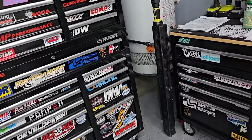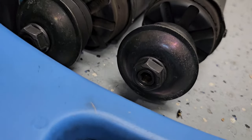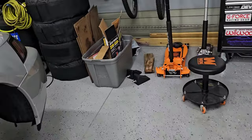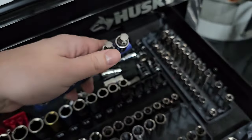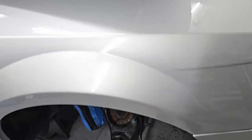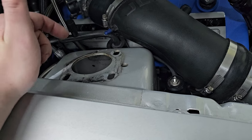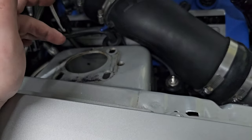Just a side note: to get the front struts off, you'll notice the nut on top has a hex — like an allen key — in the top. You're gonna need something to hold that. What I found works best is little hex sockets on a ratchet, and then you need a big wrench to get the nut off. You could take the nut off with everything connected, but it doesn't really work well — you need the strut connected to get the ball joint nut off. So I wouldn't suggest doing that.